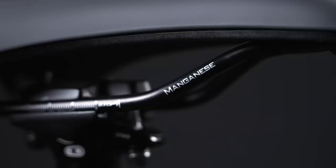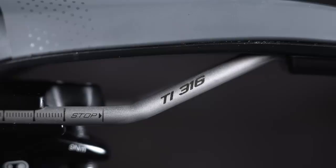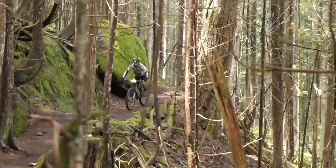Chromoly rails are brilliant — they can absorb shock, but they're generally a little bit heavier and also a little bit cheaper, so you can get a fully featured saddle that will just be a little bit weightier. If you need a lighter offering and arguably something more comfortable, titanium rails is probably the material you want to be looking at. Titanium is known for being lightweight but also a very forgiving metal, so it has slightly damping properties, reducing the vibration transmitted from the bike through to you.